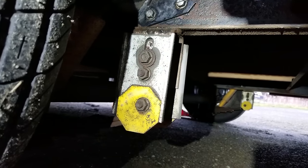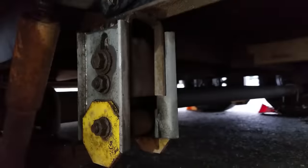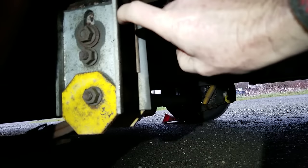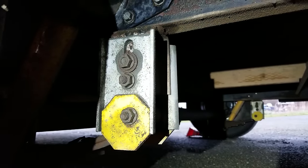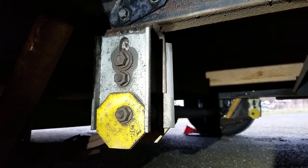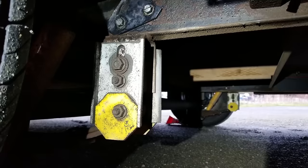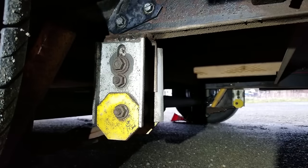Here is the Correct Track as it is installed. If you look inside, you can see the old hanger for the leaf springs, and then this is the Correct Track attached to it. The first thing you're going to notice is it's going to raise your trailer by two inches. In my case, that was a wonderful thing, but there are some people who do not want their trailer raised two inches — so you need to understand that if you put this on your trailer, it will raise your trailer two inches.